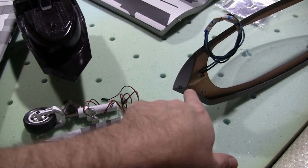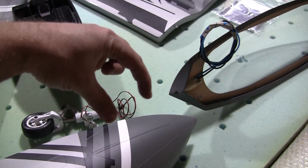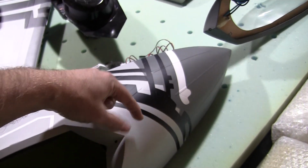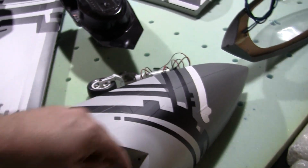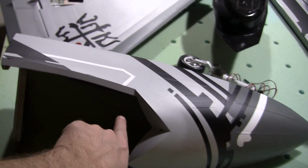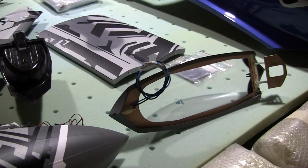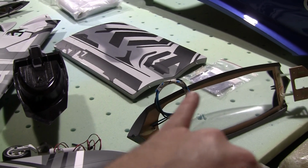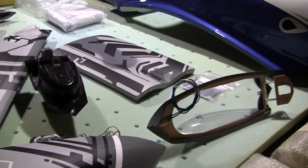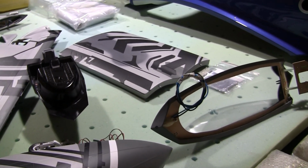Take the pin that's in the actual air cylinder and attach it to an electric actuator, a linear actuator, and I use that. That's mounted in this area, and it comes in and out through here. So I have an electric open and close, and then an electric pin that goes forward to lock the canopy when it goes down. Works really good, I think. Plus, you don't have to worry about running all those air lines down the canopy, and you get rid of an air valve. You get rid of two air valves, if you do that kind of a setup.